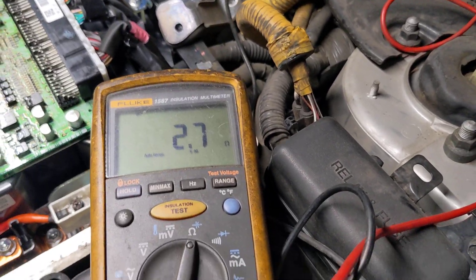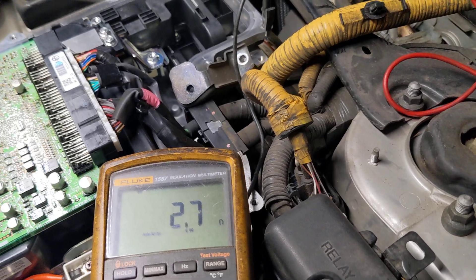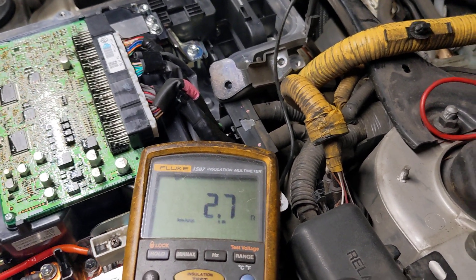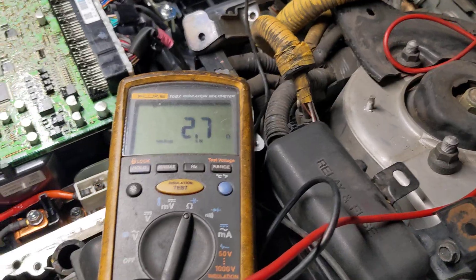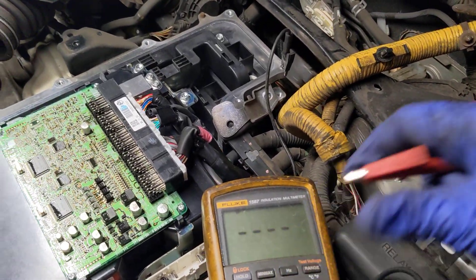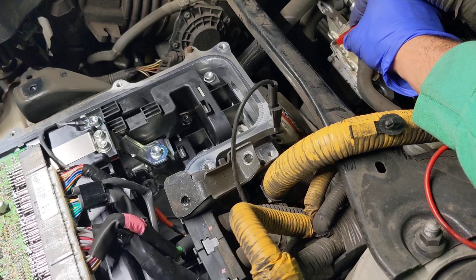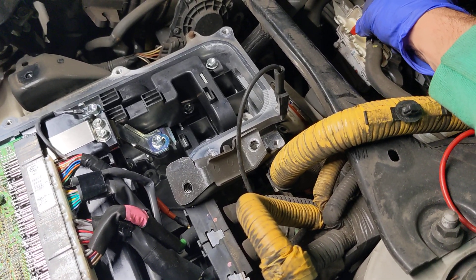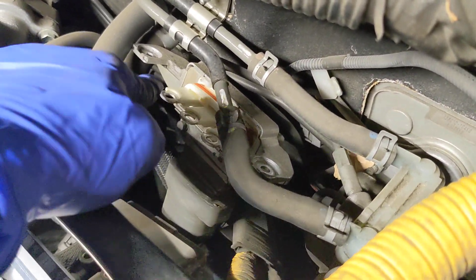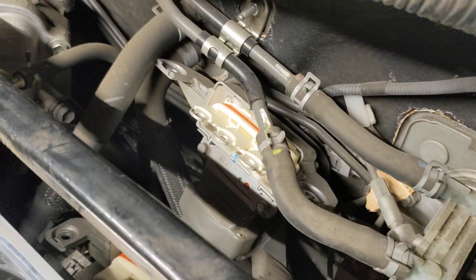This transmission has a problem inside of it. Probably not going to dig into it — might take the cover off, just the one cover off MG2. The new transmission didn't have the cables on it, so I'm going to swap those over. Also, we can put it on the sound mode, which tells us when there's a connection. If I connect it here, it beeps. Those wires that go to these three terminals all connect at the other end — they go into the stator and connect to each other, so in between here it's almost like a dead short, just a long wire.